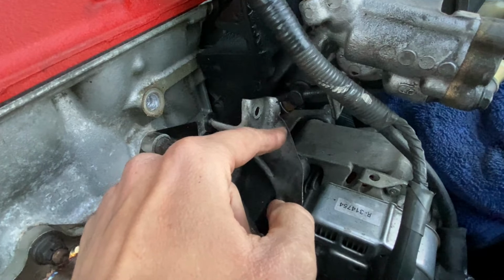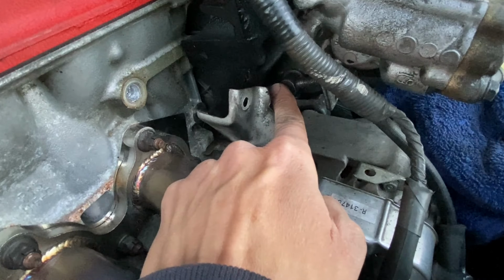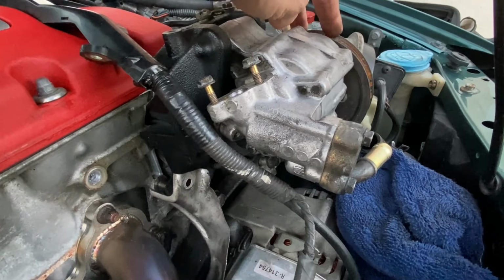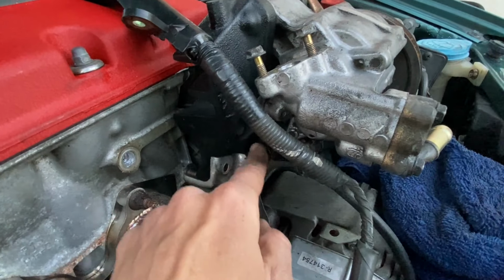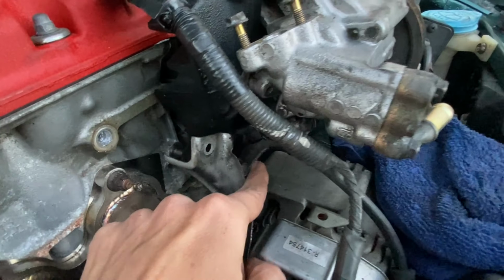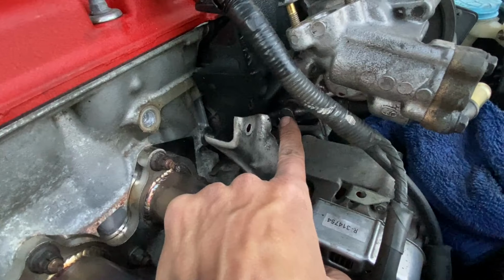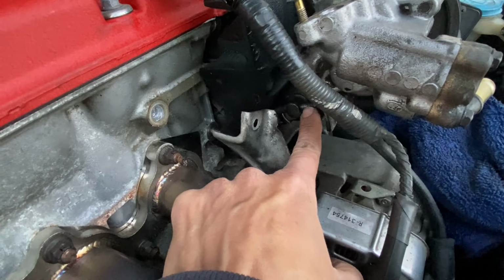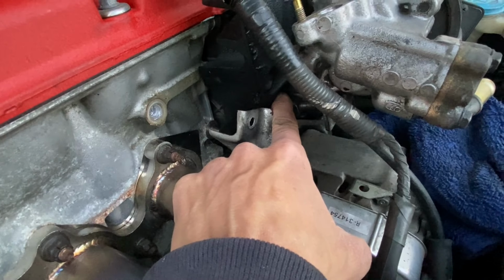All right, now here's the culprit. The first time that I was able to shut this hood, this tensioner adjustment here was all the way backwards, which means that I would have to get a power steering belt that is very, very tight, and I have basically no room for adjustment on tightening this thing up. This thing is about 1/3 of the way tightened up right now. If I put it all the way backwards, obviously it will not shut. But if I put it all the way loose to the backside right here, the hood will shut.